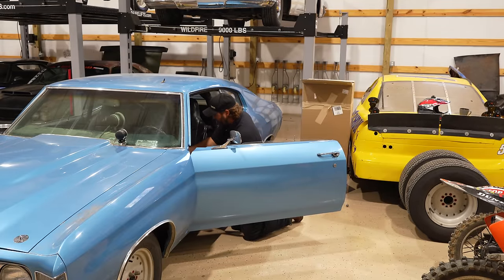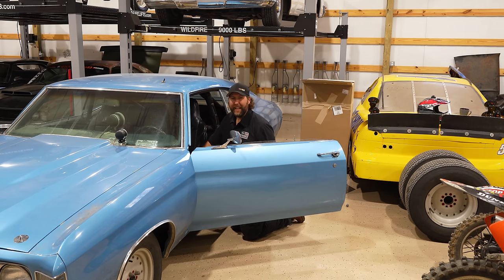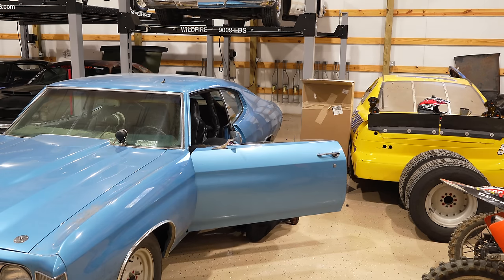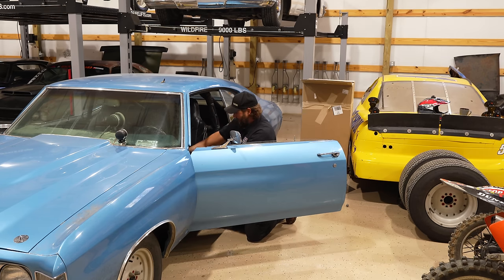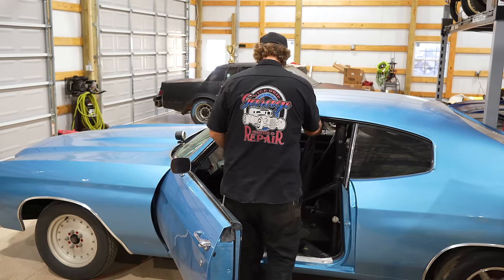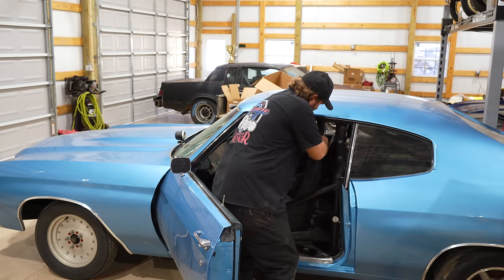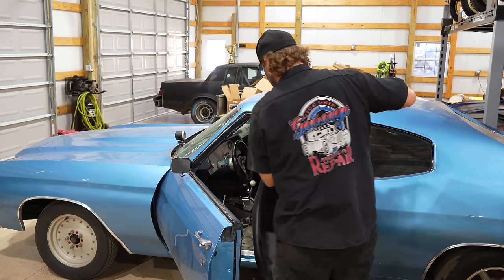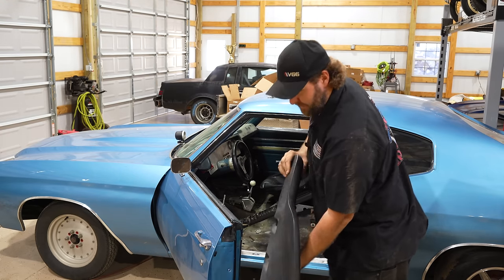I found the SFI tag on the belts — it expired August 1988. One of them doesn't even have a nut on it. Seat is out. Overall, the floor is in decent shape. She's had some rearranging — there's some filler material, I don't know if it was to fix rust or partially for the cage, because we've got some patching up here as well. The seat's been moved a couple times, probably forward, and that's why we have all these holes.